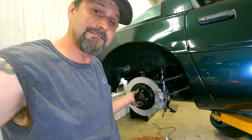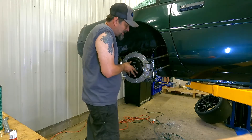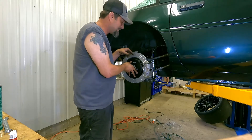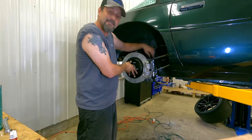I've got this hand tight with the caliper, just holding the rotor to make sure that the spacing on the rotor isn't hitting anything when it's flush — top, bottom, either side. Now that I know that when the rotor is flush it's not hitting the bracket anywhere, I'm going to pull this off, put some Loctite on it, and tighten it all up.